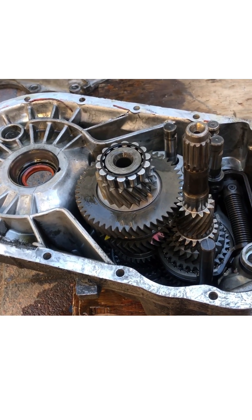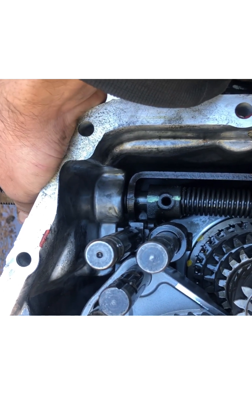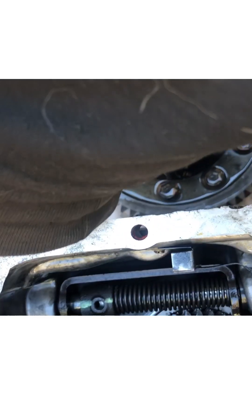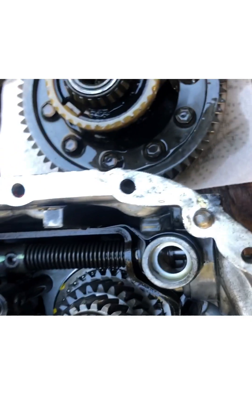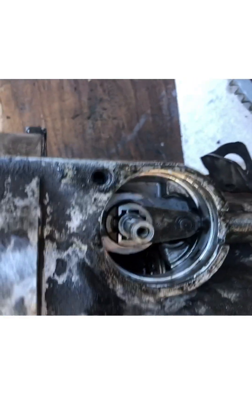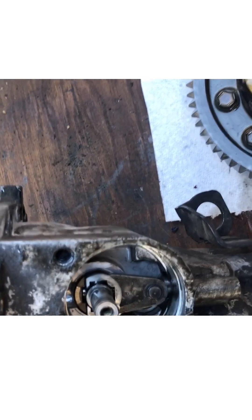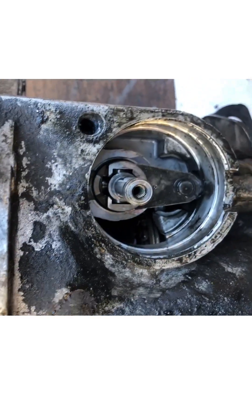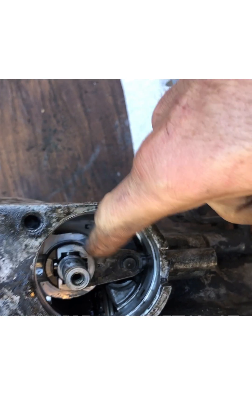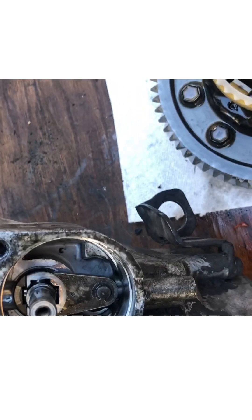The roll pin is punched out and sure enough the shaft still doesn't want to come out. It does move left and right, so I think the rear is holding it. Unless there's a notch I'm not seeing, I'm going to take the reverse plate off and see — maybe it needs to rotate 90 degrees. There might be notches on the other side that I can't see because it's in the way. At this point I'm just going to go at it.